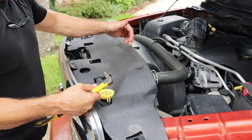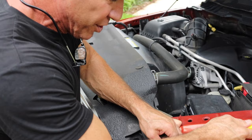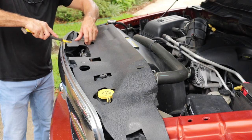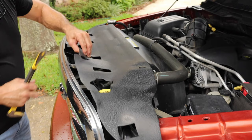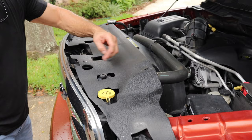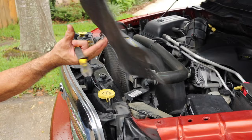Be very careful — once you release it, it comes right up. I don't want to scratch my paint; you can always put a little rag underneath there. It doesn't take a lot of pressure to pull them up. Some may be stubborn if they're old and they'll even break sometimes on the back. If they're really old and stuck, you can buy these in the help section at your automotive shop — they have little packets of different size ones. Take it up as one piece so all my buttons stay in place and I can set it to the side.